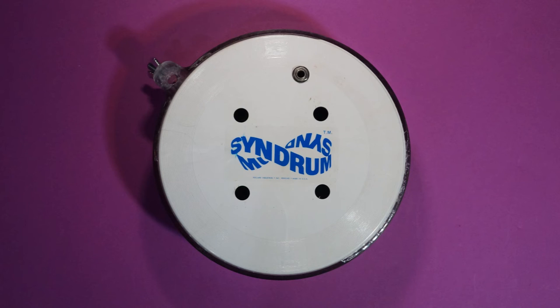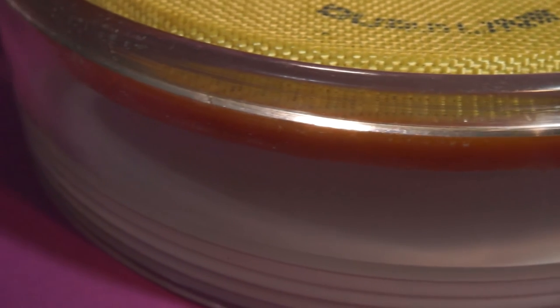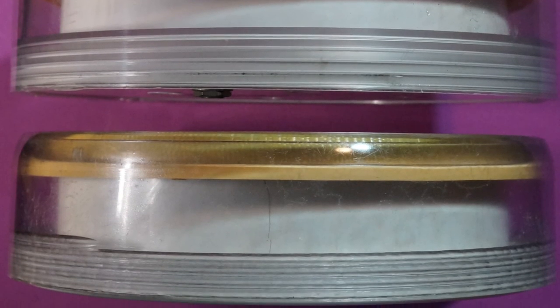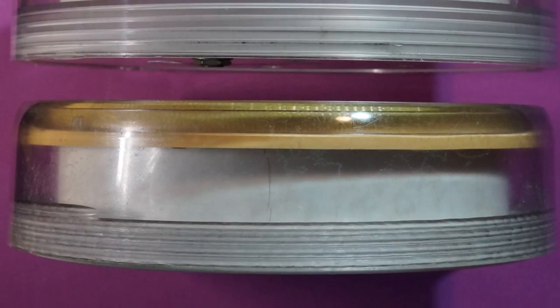If your module comes with pads, you'll probably find foam that has disintegrated on the inside that will fall out through the holes underneath. Be sure to clean this completely. Finally, check the casing for any fractures and cracks. This could be a sign that they're ready for display only, rather than damaging them any further through continued use.